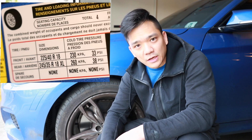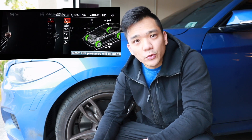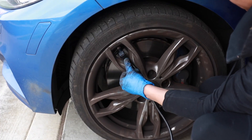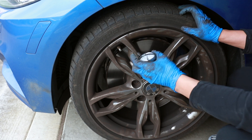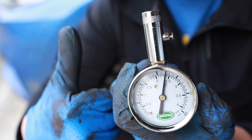We put in the last tire but we're not done yet — there are only four tires and we've rotated them all, but the last thing we need to do is an air check. On the 2 Series, the front tire is 33 PSI while the rears are 38. If you're unsure where to find the correct tire pressure for your car, check the inside of the driver's side door seal. I know BMW has a TPMS — the tire pressure management system — where the car checks pressures while driving, but by that time it's too late. You should know the tire pressure when the car is standing still. Just get a pressure gauge, put it on the tire, and check it. If the pressure is off, add more; if it's too much, let a little out. By the time the car is rolling it's too late.